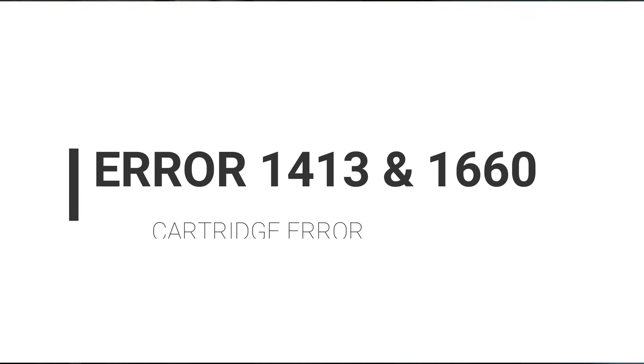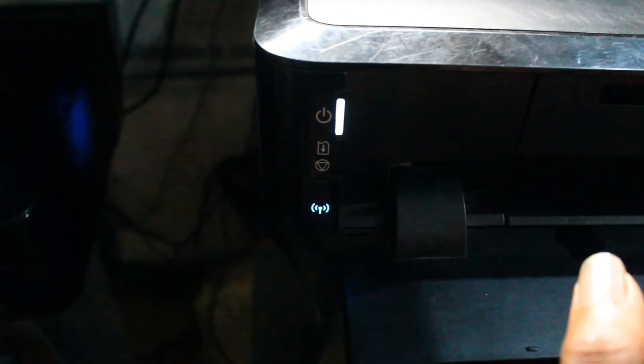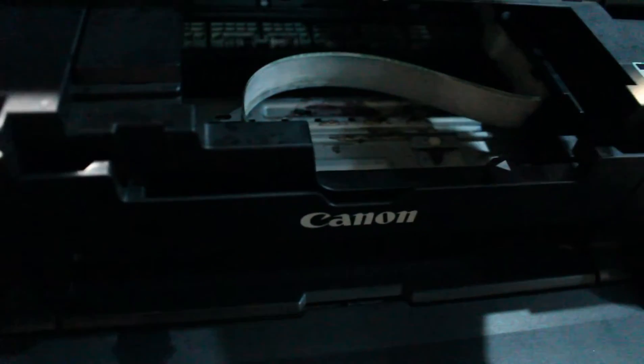You can see that this one is stable. This printer was complaining of this cartridge. So I took the cartridge that was working and put it inside the faulty printer — and here it is still complaining. I took the other cartridge and put it in the printer that was okay, and it's okay. So the problem is not with the cartridge — the problem is from the printer.